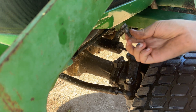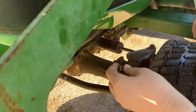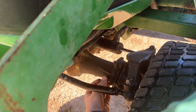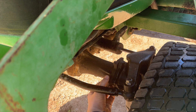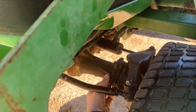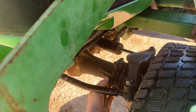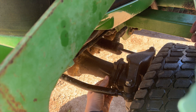I took one of the bolts out to go look at my hardware and find one compatible with the same thread, so I'll go ahead and install these and get them all tight. I have seen some people who've had to replace the seals and bearings on the inside of this axle housing, so I'm sure someday I'll be doing that as well. There must have been a problem for someone to have taken this apart — or they just rattled loose over time. Eventually I'll probably be taking this apart, getting a new gasket, new seals, and new bearings. For now I'm just going to put it together so it's at least tight and drivable.